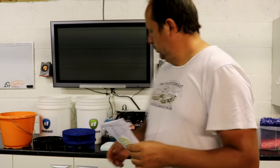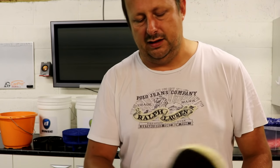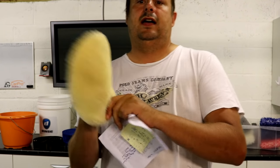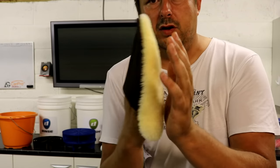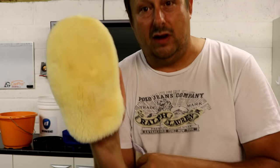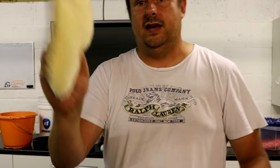The next bit of equipment you'll need is one of these Chinese wash mitts that I keep talking about — I'll put a link in the description. You buy them on eBay; there are millions of vendors selling them. You recognise them because this bit's brown — they're called lambswool but they're synthetic apparently. The reason I use these for this one bucket method is because of the size and the depth of the nap, which makes it easy to rinse this mitt out — and we'll talk about why that's important. I'd recommend you buy a ton of these because they're so cheap, like £1.20-£1.30.